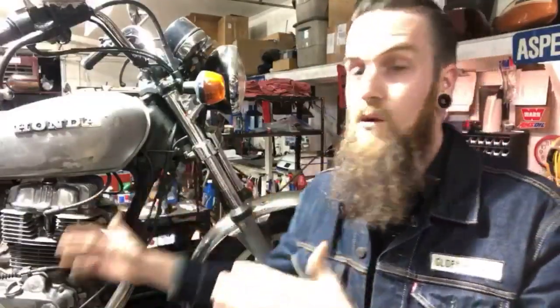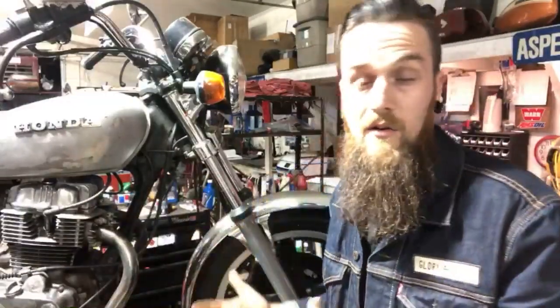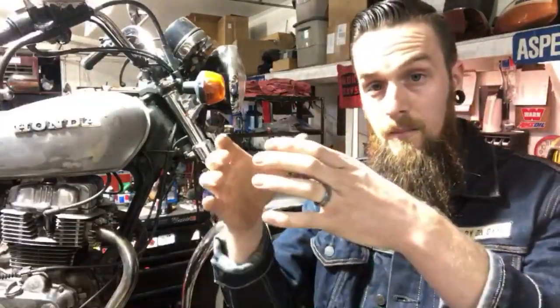But if you take the oil cap out and you have air, you can put your ear up to it and hear air rushing out of the crankcase. It's going past the rings into the crankcase. So that's where the problem is. So I have a feeling that the left piston is gonna be slam stuck. The rings are gonna be stuck on it, or I don't know.